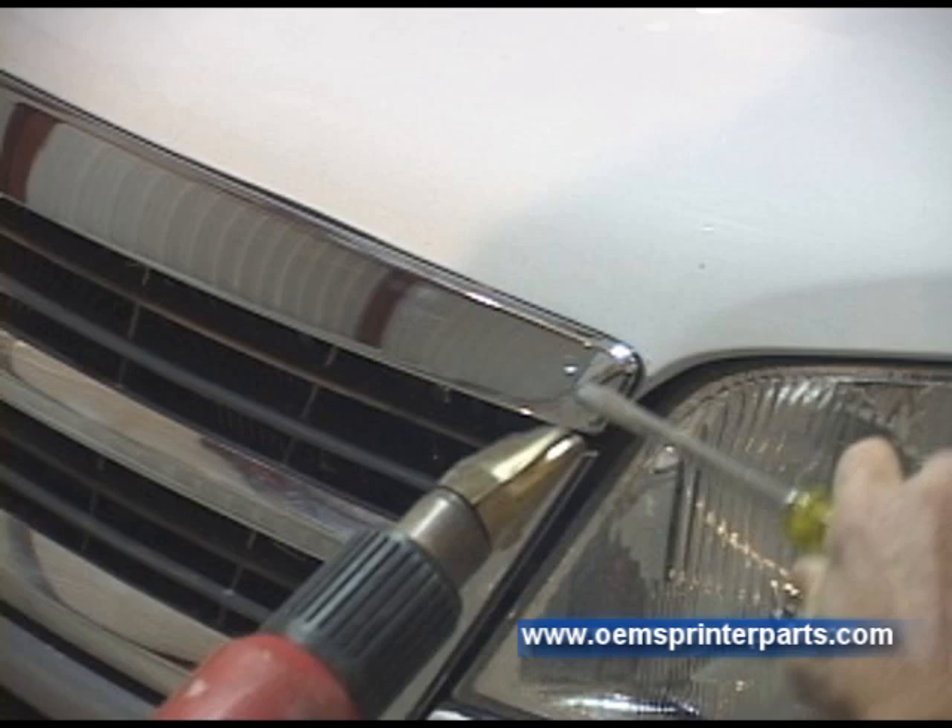The chrome trim is made up of two parts: one chrome plastic strip mounted on a black plastic base, which is attached to your hood using double stick tape and, in most cases, a durable black rubber adhesive. This is extremely hard to remove and extreme caution must be used to avoid paint damage.